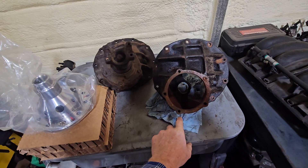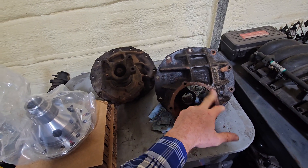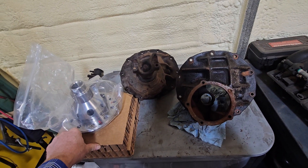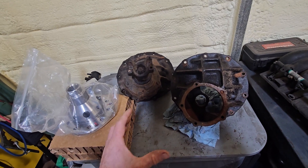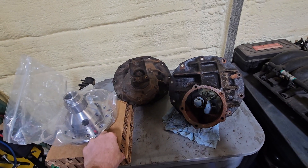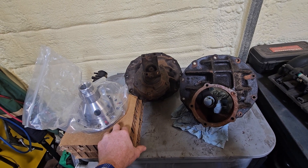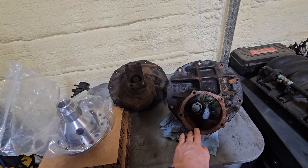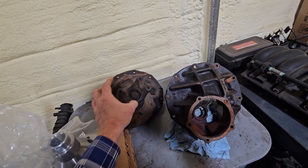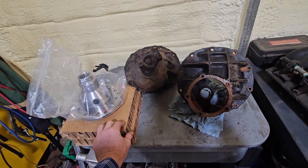Here's the carrier — I got carrier bearings for it. On gear ratio, I've been running numbers again. I tend to get lost in the calculations. I wanted to run a 3.73 initially, but with a 28-inch tire and the 4L80, it's just going to be turning more RPM than I want cruising at 80 mph. I think a 3.25 is going to be the gear ratio I end up with, paired with a 275/60 tire on the truck.